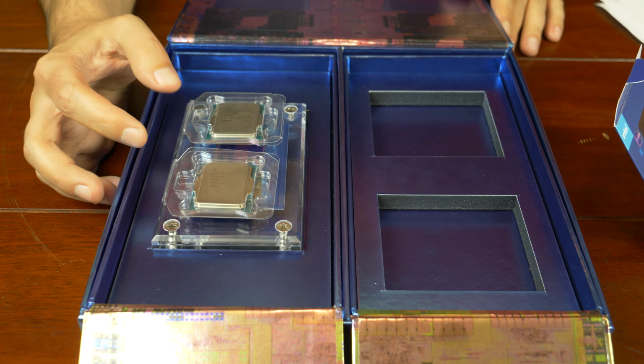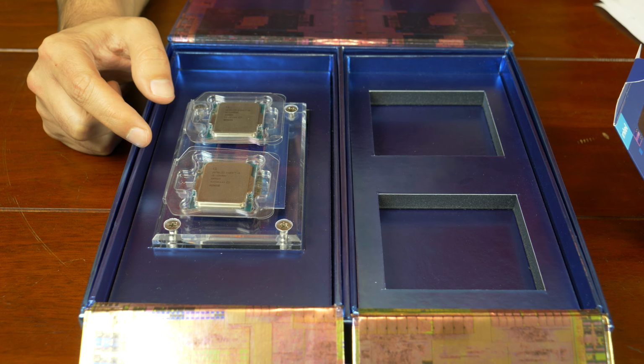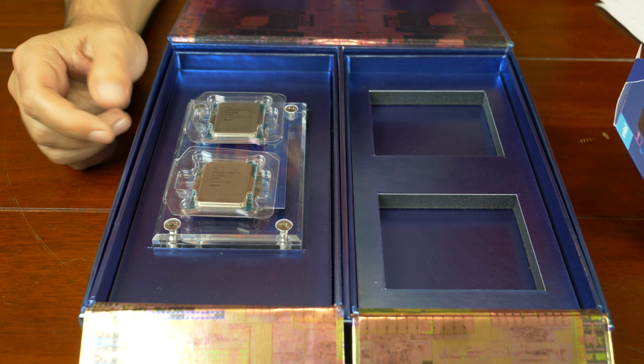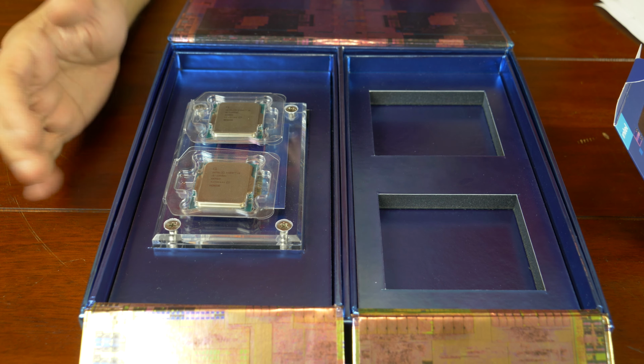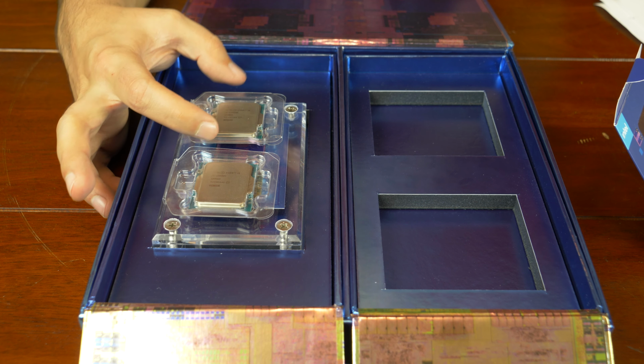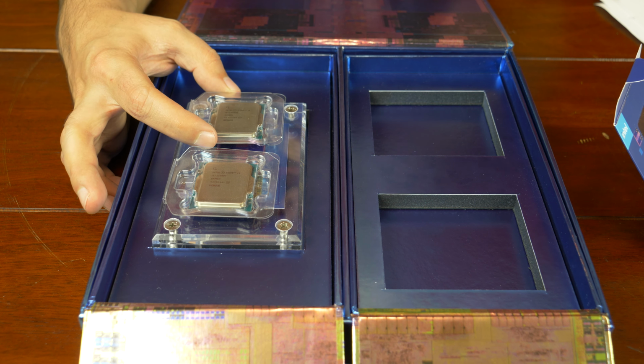Anyways, let's go to the L2 cache real quick. Now there have been big improvements to L2 cache too. We saw the L3 cache has been increased, but the L2 cache has also been increased. So you basically get DRAM, then L3 cache, then L2 cache, then L1 cache, and then it's fed to the cores. So the cache is smarter and it's bigger. Now the cache sizes, okay, so L2 cache on this thing is 32 megabytes.